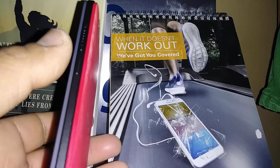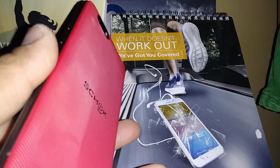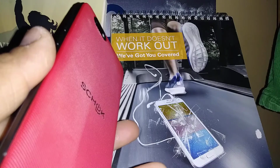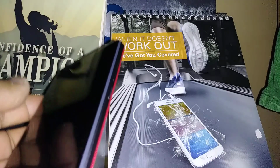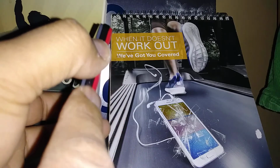The purpose of this is to remove any password, pattern, or PIN blocking the screen of the phone. Consider that pictures, videos, contacts, email addresses, passwords, downloaded applications, everything stored in the phone's memory will be removed or deleted. Okay, with the phone powered off, you're going to use the volume up key and the power button.